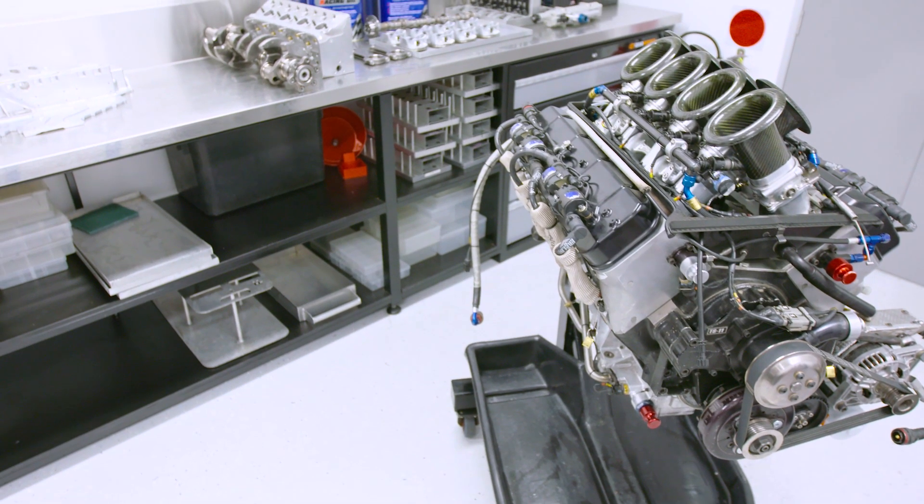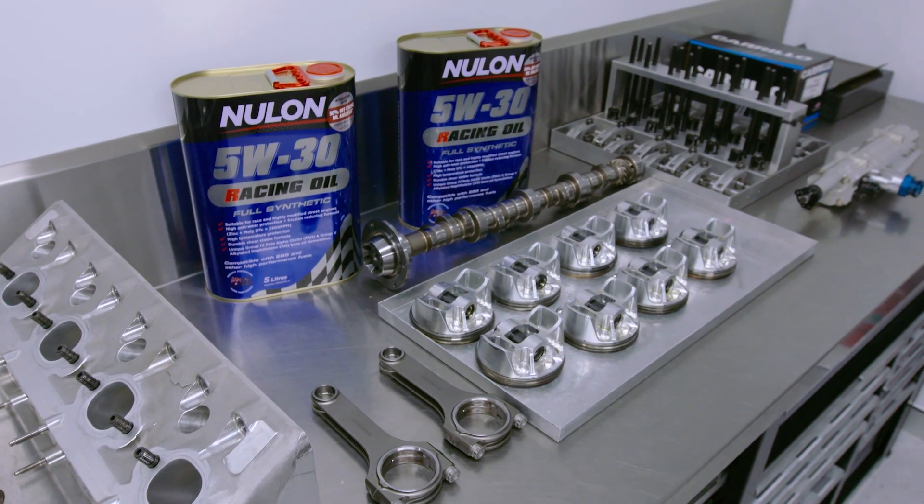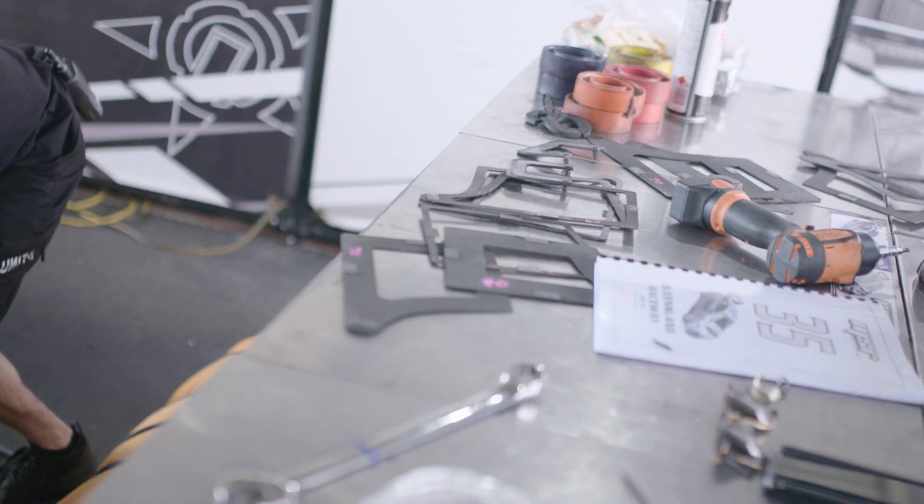On the engine side, we do dyno runs — our engine supplier tells us our optimum temperature to run at, and we adjust throughout the day. It's always better to add blanking throughout the session than to take it away. You go out, give the driver the confidence of the downforce on the front, then if you take it away he can understeer into the corner. If you give him downforce on the front, it just means he has more turn.